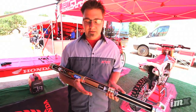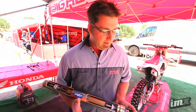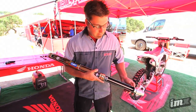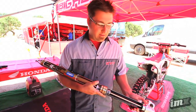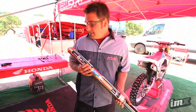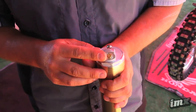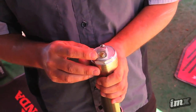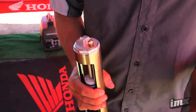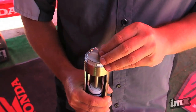This allowed us to have way better resolution on the valving. We were also able to increase the bottoming cone size — the bottoming cone is much bigger than any other fork we've been using. Last but not least, there's a new compression adjuster, Honda exclusive. No more fighting with a screwdriver to change your compression damping. One of the biggest benefits of this fork is how easy it is to adjust.